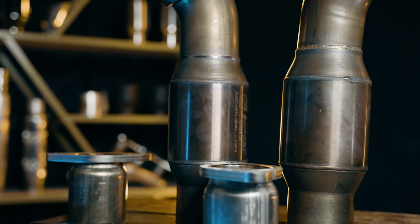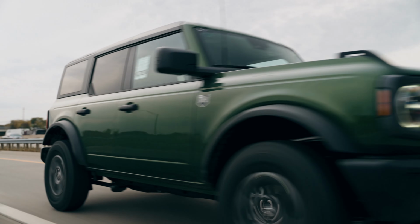Well, we have some. Whether you're going to your factory downpipe or factory exhaust, we got you covered with tubing transitions. If you're going back to a factory system in either way, these neck down to 2.5. You probably don't want to do that, it's pretty small. You'll then be granted this big old boy right here, 3 inches, to get all the maximum horsepower and gain from our downpipe to our catback.